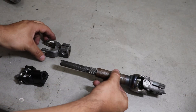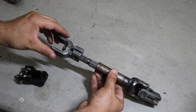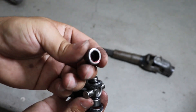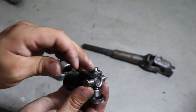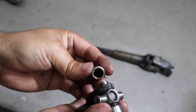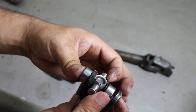Next, you want to make sure that you have the collar that slides right over the Prius shaft. We're going to use the U-joint and connect it with this guy. To install this, be very careful because those needle bearings will come out — I suggest putting grease on them to help them not slide around. You're going to want to push the U-joint all the way to the top while getting your cap and slowly and softly making sure that it's 100% in.